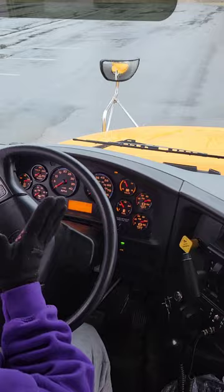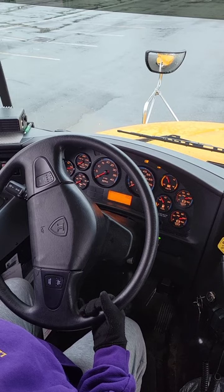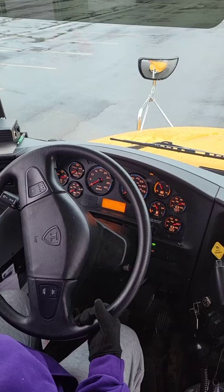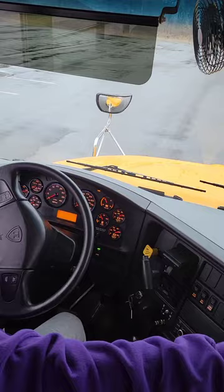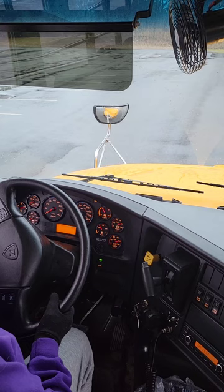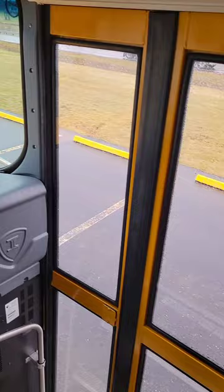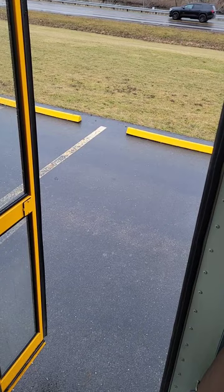Then you ask them: will you please go around to the rear of the bus? Because they've already done the side. Start top down: clearance lights — yes. Amber student warning lights — yes. Open the door: red student lights and stop sign, because there are still two red lights on the back of that stop sign you will not see in the mirror — yes and yes. Close the door. Left turn — yes. Right turn — yes. You don't want to have them do the rear and the right side because then they'd have to go to that side and you will not see or hear them. Four ways — yes. Tail lights and then brake lights — yes. Please come back to the door. When they get up to the front: clearance lights, right turn signal, four ways, step light and entrance light — yes. That completes my pre-trip.